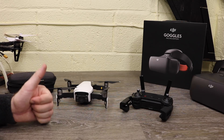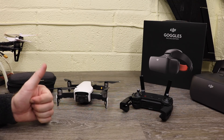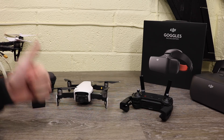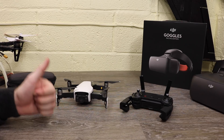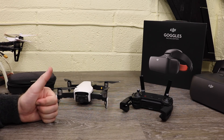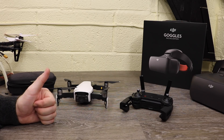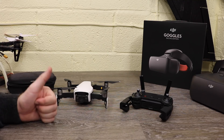If you do calibrate it, I'd recommend making sure that it is completely cold first — and I don't mean put it in the fridge. The only time you should need to calibrate the IMU on a modern new DJI aircraft is if the app warns you to. I have several of the new ones and I have never calibrated the IMU on my Mavic Pro or my Inspire 2. It has simply not been necessary.